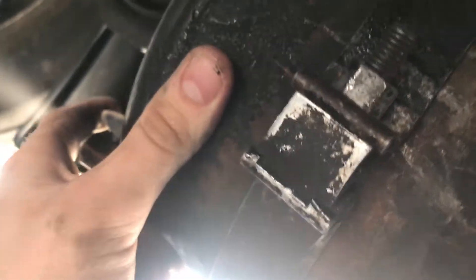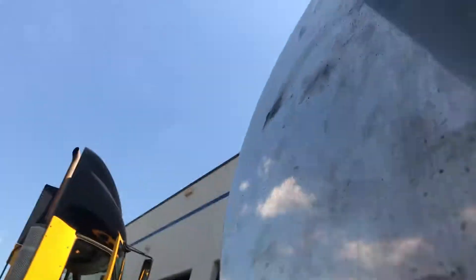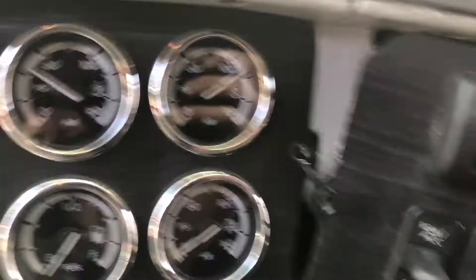All right, so we've been draining this for close to a minute now, so we're going to crawl back out from underneath here. Did we lose air from secondary? No, primary only. All right, so we've only lost air from our primary tank, so we know that the valve works for that side. Now we'll go ahead, go back down there, drain our secondary tank, and see if we lose anything from the primary or not.